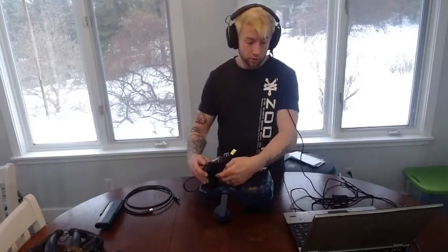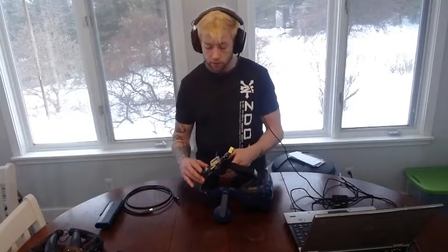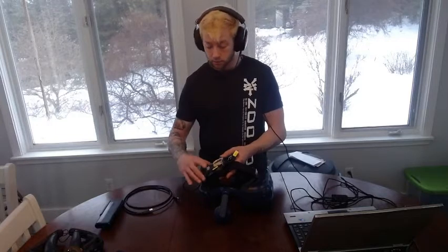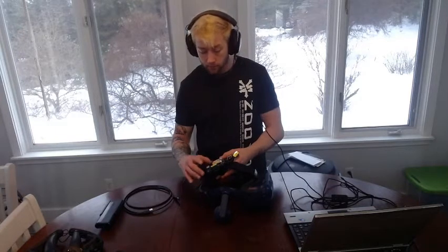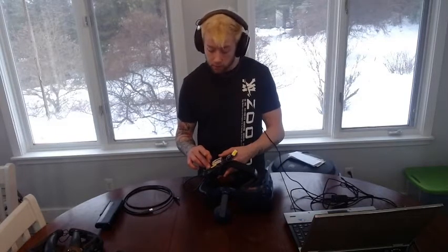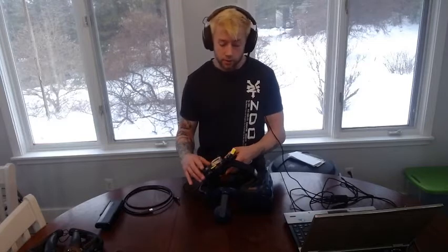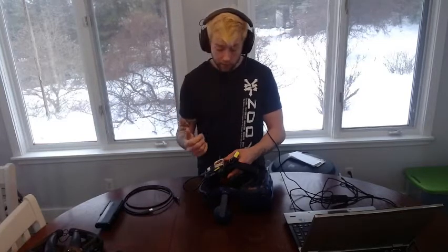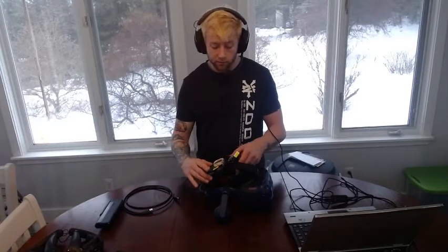As is well documented and shown here with the big heat pad, this unit does get super hot. The heat seemed to heat-soak the wireless card inside, and from that it would cause a disconnect. What most users did to fix that is put a fan on top using a 5-volt mount.